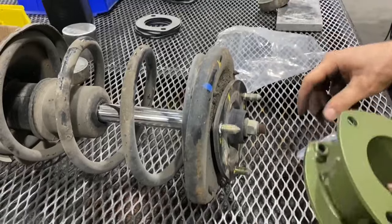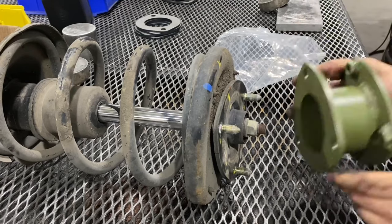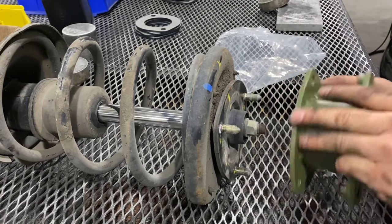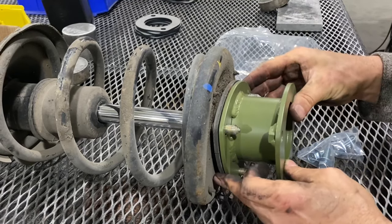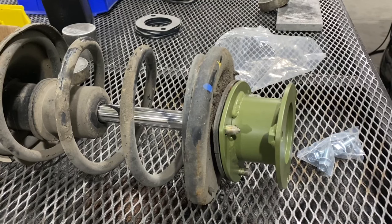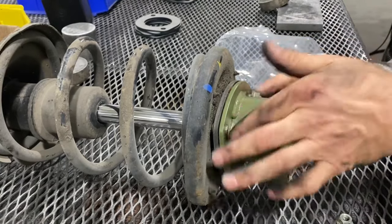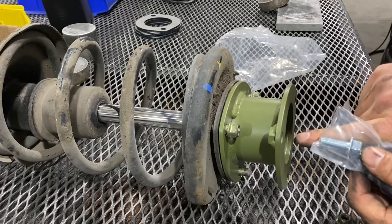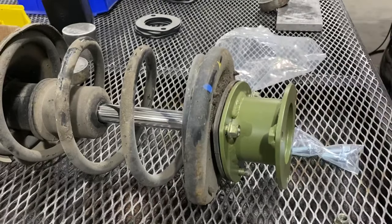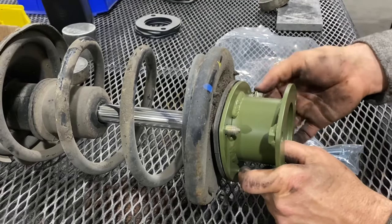It comes with hardware here — you're going to reuse the factory nuts to mount it to the strut. As you can see it's not completely symmetrical and it will only go on one way; you can't put it on wrong. It's made to fit on just like that, and then you use your factory hardware to install this to the strut just like so. You'll use these bolts to come in from the top of the shock tower and into the spacer.